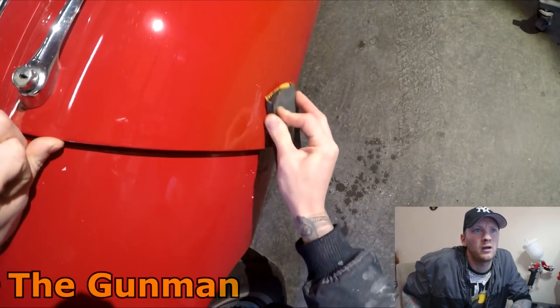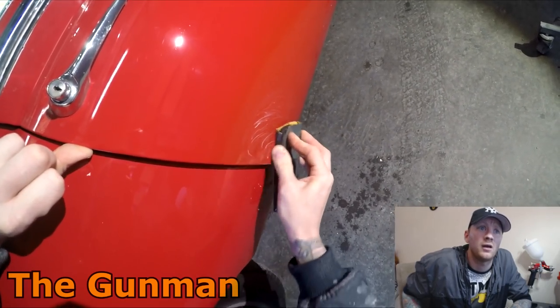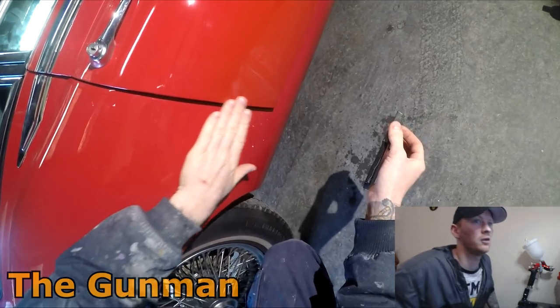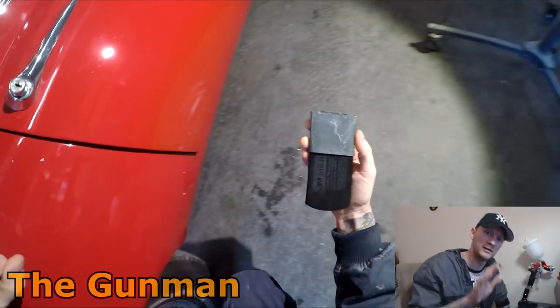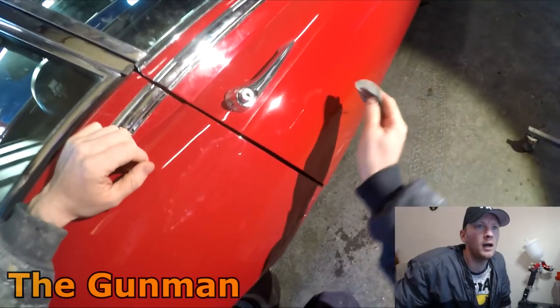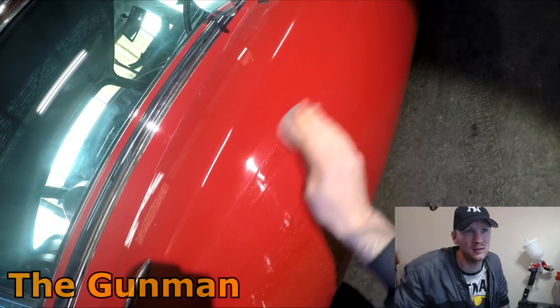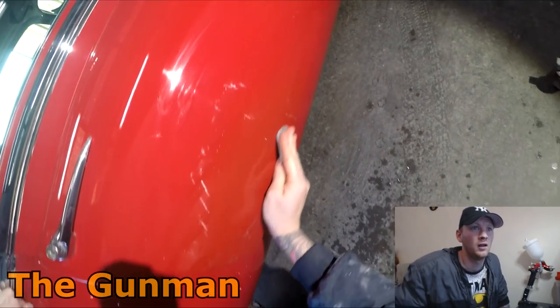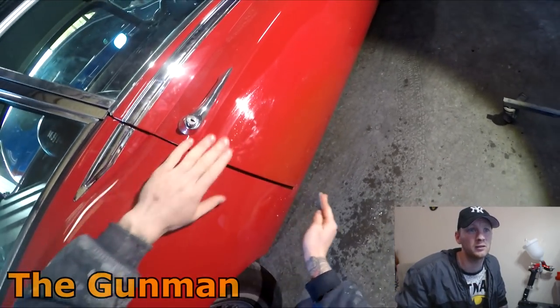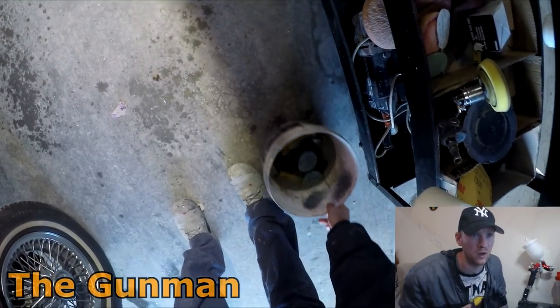Just giving it a bit of a block down now — 1500, I think I was using. You could use 2000 if it was only a really small run. If you go too fine though, all you'll end up doing is sanding over the run, then you'll polish it up and find you've got a bit of a shadow run underneath it. You do have to be careful sanding the edges of your blend, but sometimes it needs to be done. As you can see I'm very lightly scuffing it over — there's more than likely a couple of small bits of dirt or nibs inside it, so I decided to sand over it.